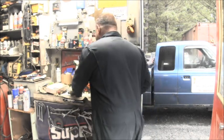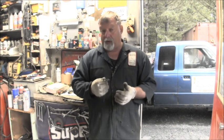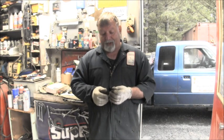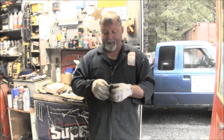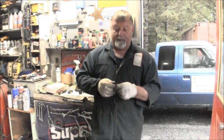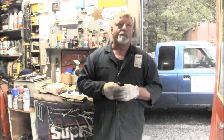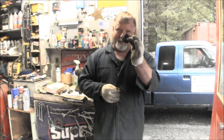And these diaphragms... I've got another video, and it's titled something like Yamaha 9.9/15 Common Problem. And these diaphragms will cause these things. It's really frustrating because they're like $7 each for these little things. And it's just not a good design. I mean, I don't understand. I got like the Evinrude diaphragms. With the Evinrudes, the diaphragm, that spring system and all they got seems to alleviate this problem to a large degree.